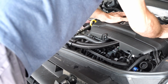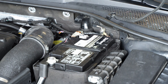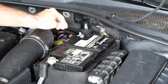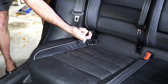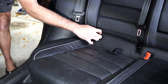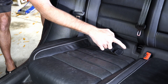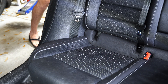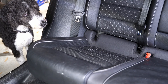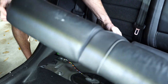Once you know you're low on fuel, we can all start from the same position. I am going to take off the negative cable on the battery just to make sure there's no power going back to the harnesses on the low pressure fuel pump. Then to remove the backseat, you'll need to remove these little plastic covers. The top one flips out and then the bottom one you push down and then rotate it to release it. Then pull up on both sides of the seat, push it back, lift, and then pull forward to get it out of the hooks. The seat comes out fairly easily.